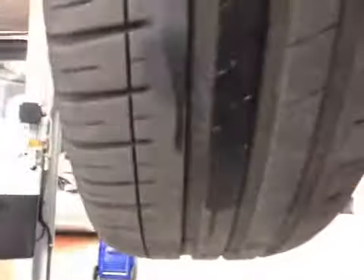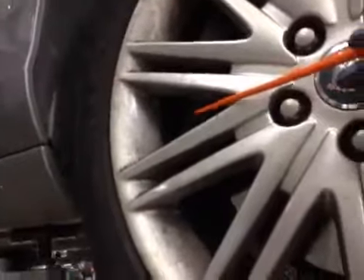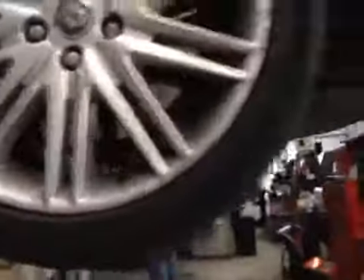This is the driver side front tire. The tire is between 3-5mm of tread again, no signs of foreign objects inside the tire. Front disc has a slight lip again, and your front brake pads are on 4mm. So the pads are in amber, disc is in amber, and the tire is in amber on the health check.